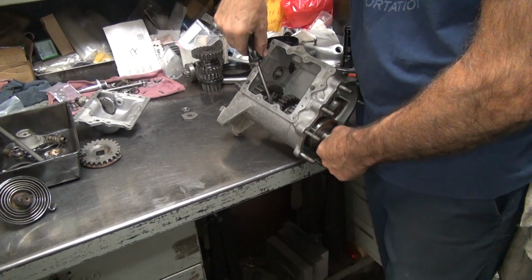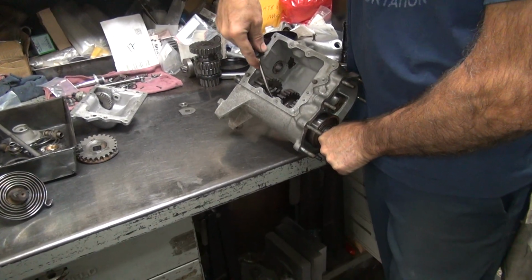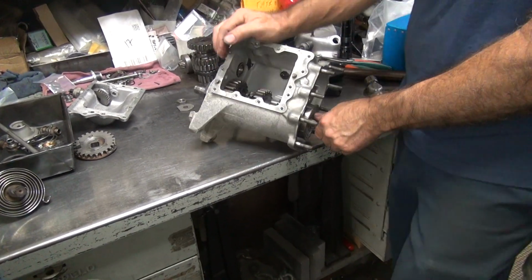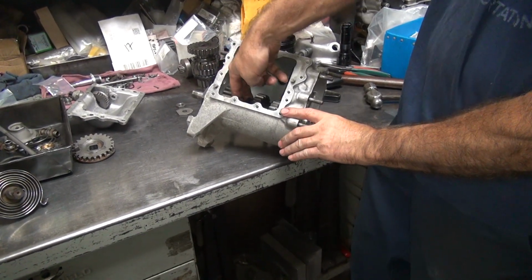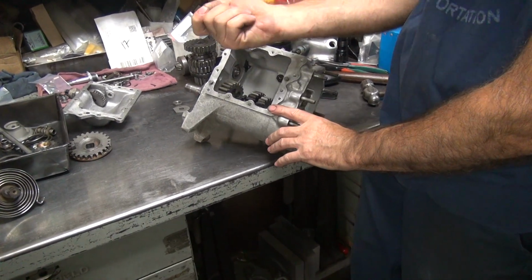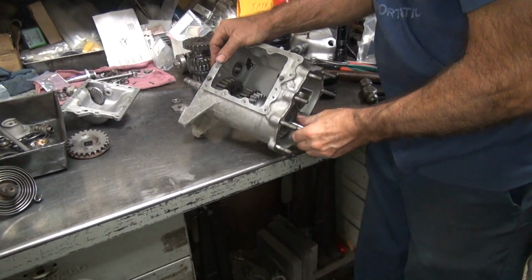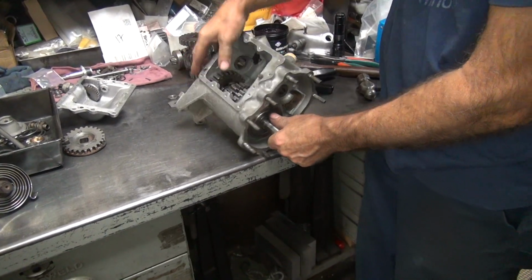Most people put that gear in, they leave them real sloppy, like 30 thousandths, and they don't shift right. Okay, now once you get the snap ring over the spline, you put the slider or the dog in there, and you just push it over with that. It takes the fingernail off too when it goes in. Okay, I think it's all in now.